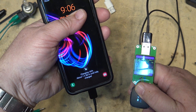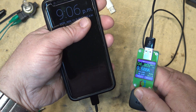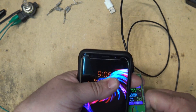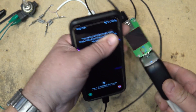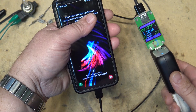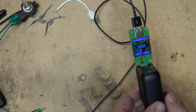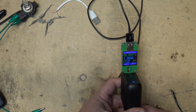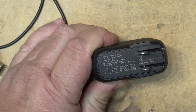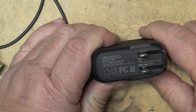Fast charging shows 65% charge with 45 minutes until fully charged. On a regular 5 volt charger it shows one hour and 38 minutes until fully charged. Switching to the QC charger brings it down to 45 minutes until fully charged — so it is a fast charger that charges at higher voltages. This one shows as QC 2, though the specs on this unit are QC 3. It may only show QC 2 due to a limitation of the cable used to connect to the phone.